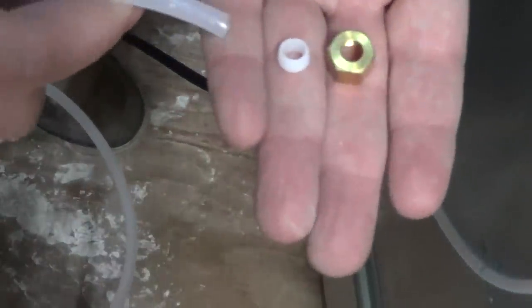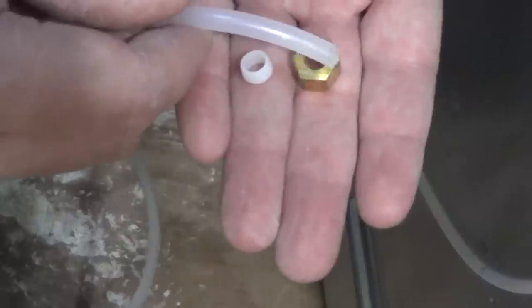Now we're at the connection to the fridge. The only difference on the fridge side is there's no ferrule — that sleeve that goes inside — it looks like it's just calling for the compression nut and compression sleeve to go in directly, maybe because this is steel down there. I'm going to try it, and obviously if it leaks I'll stop it and go get a ferrule, because some diagrams say you need one, some say you don't. The fridge diagram says you don't need one, but the actual kit says you do — and there isn't one in the kit.